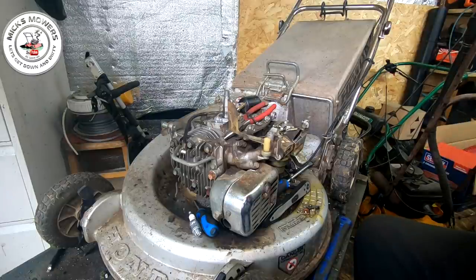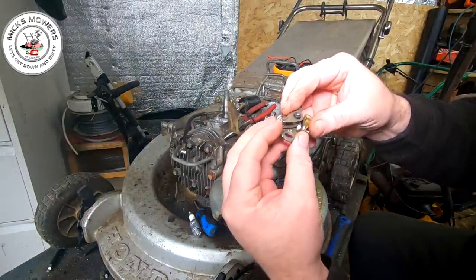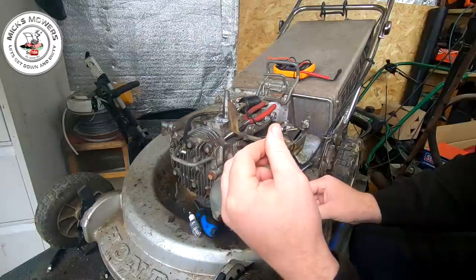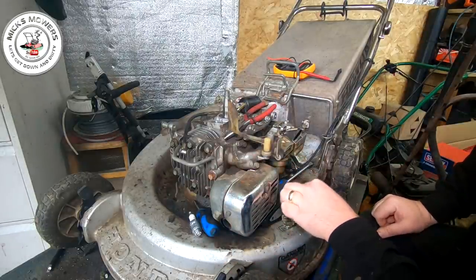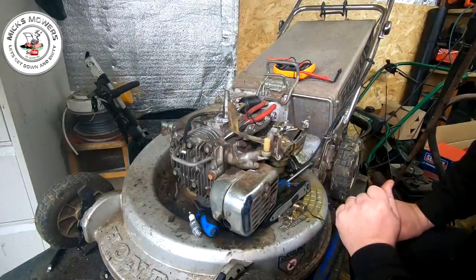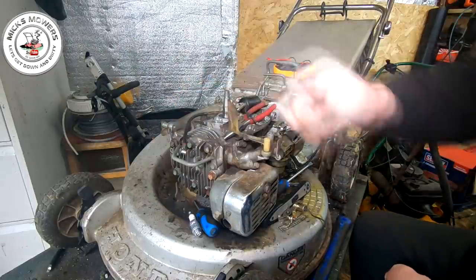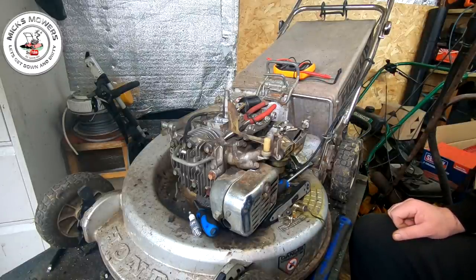I've rung the owner up and told him my diagnosis. I think it's actually this little set of points — there's a bit of black blacking on the front of the points just there. So I've ordered a new set of points and also a new condenser. You can get those kits off Amazon for about £24-£25 — daylight robbery. They're coming tomorrow, so I should be able to fit a new set of points and condenser and we'll go from there. This will be part one of the video and I'll do a part two. I was a bit suspicious of the HT lead boot at first but that's actually good and caused no problems at all.